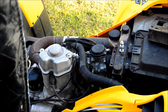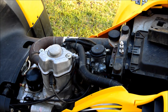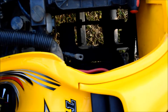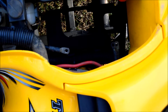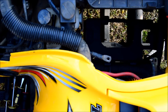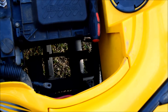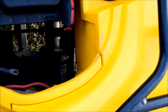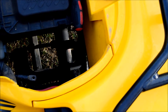Unfortunately I can't show you the drain because of the camera angle, but we're on the right track. Next up, I'm going to drop the battery in right here. You can see where I repainted everything down in there — I used some Rust-Oleum stove paint, but I cleaned it up first with a wire brush, blew it out with air, and wiped it down. If I see a rust spot on something I'm fixing to cover up, I'd rather go ahead and take precautions now. When we come back, I'll have the battery in and we'll try to get the fuel pump to come on and pump some fuel out of that carburetor.